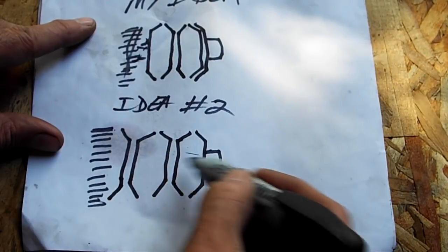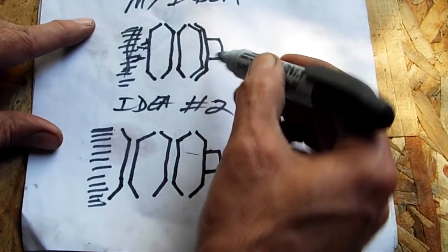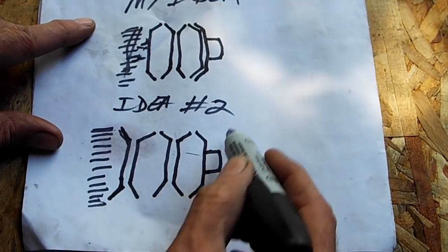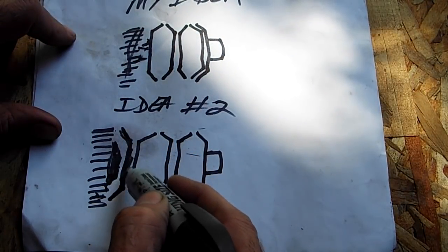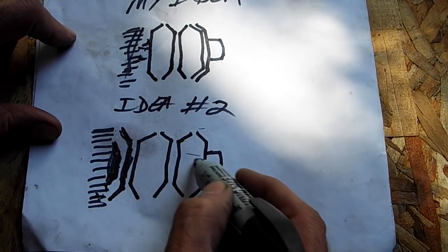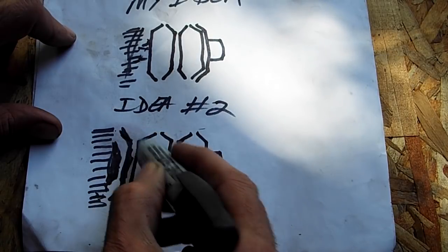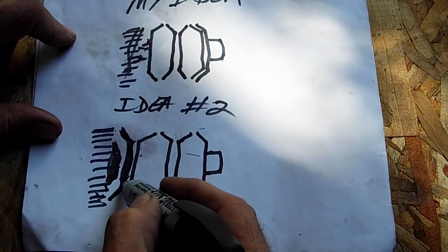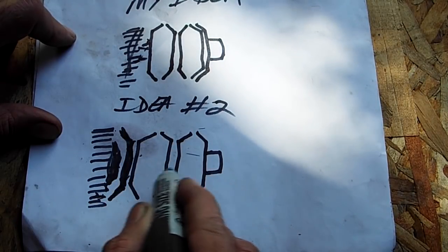So I left these four alone. I took that fifth one of my earlier idea and instead put it facing out in the cup that's inside the stator rotor. So I think adding this extra washer to the front against the other four inside the stator rotor cup, it acts like a shim. So it's 1/8 of an inch thick, and it's pushing 1/8 of an inch more against these other four springs.